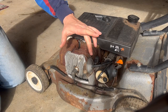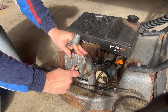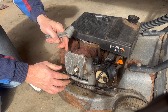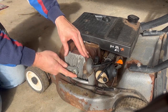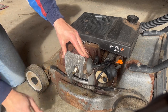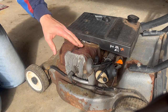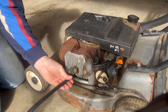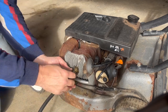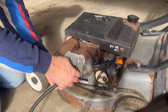To start with, I'll leave the decompressor in the engine head, just to show you how it doesn't test the compression correctly. So I'll remove the spark plug boot, take the spark plug out with our spark plug tool, put that to one side, and then wind in our compression tester, just like this.